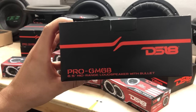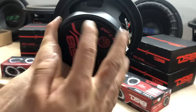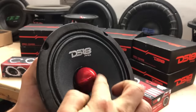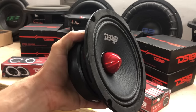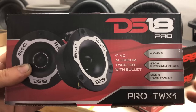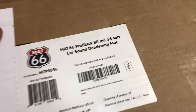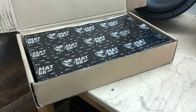Figured I'd give it a try. For the speakers we got six and a half inch pro GM 6B speakers — these things look really really awesome, big old motor on this fella, nice red spider in there, and I love the little billet dome they got going. DS 18 Pro — these things look really awesome, I think they're gonna look great in the doors. Then we've got their aluminum super tweeters, the Pro TW X1 — these have a one inch voice coil, all four ohm speakers. Over here we have some Matte 66 Pro Black 80 mil sound deadening — 50 bucks gets you 36 square feet, which is an awesome deal. I'll leave a link in the description. Also have an amp coming in to power these — for now we'll use the amp I have in there.